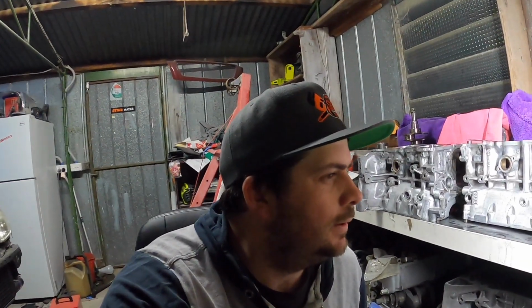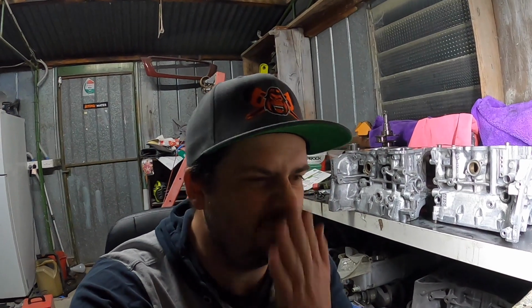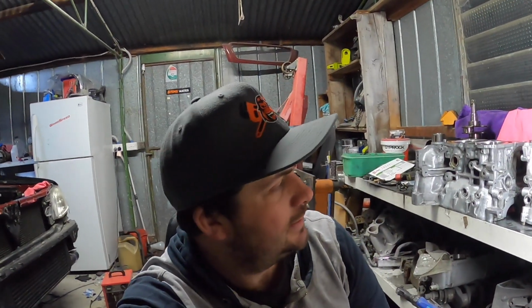So I've been sitting here for a little bit. It's like past midnight now, and I didn't get those measurements right. I did piston, bore, minus. I found the difference, but I didn't divide it by 2 to find the piston to wall clearance. So I've actually still got quite a bit of meat I can take out. That probably means that I might need to get new piston rings, because they are pretty big at the moment. I'll double check it again, but I need to divide those numbers by 2, because obviously you've got both sides.